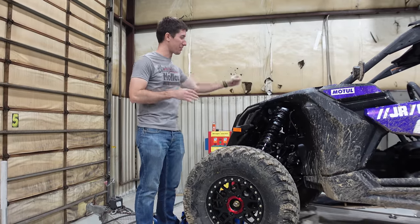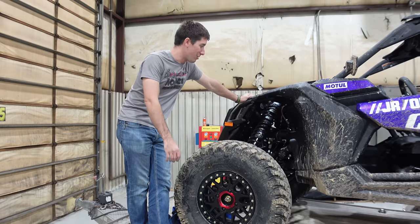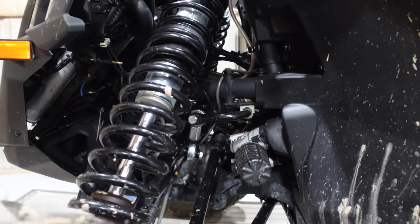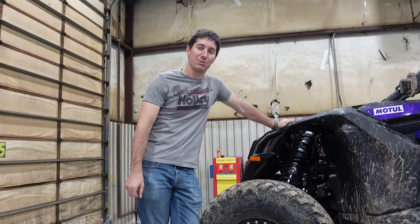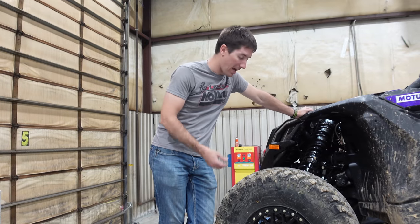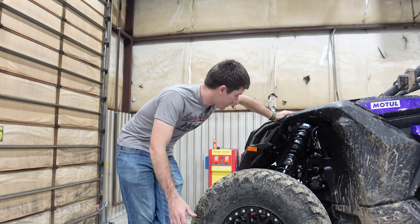Unfortunately I stopped because I took it through a ton of water — the water was up to here — and the water kind of filled the radiator and it was steaming, which made me wonder if maybe it caused an issue with the radiator. Of course it didn't. While I was checking that, I noticed that the bolt on the new gusset backed out. It's still in there and still holding everything in place, but it did break after just four hours. I need to run that back in and put a nut on it. Obviously I didn't think it could back off because it has nylock nuts on it put on with the impact, but apparently it needed to be way tighter than that. So I'm going to slide the bolt out the back, flip it around, put it in the front, then put another nut on there and absolutely bury it.